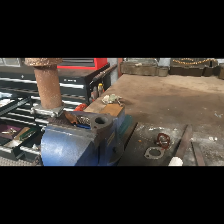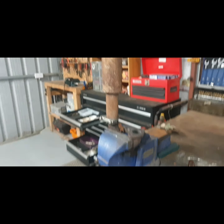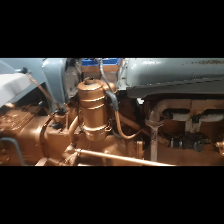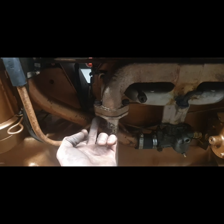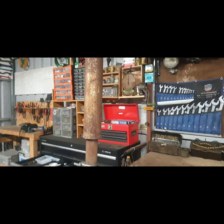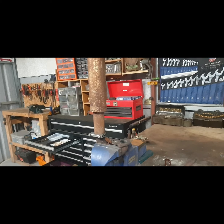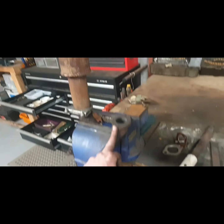At least now I'm in a position — because I've drilled and tapped out the studs in the other manifold — I can now take this off and put it on anytime I want, if I do want to see what it sounds like with the vertical exhaust, and then easily put back on the underslung exhaust. With this manifold I had to drill out the studs completely, but I put in bolts. With the other one I drilled and tapped, so I'll be able to use bolts that look a bit neater and more original. I'll be able to use this — it's a Burgess exhaust, or Burgess, I don't know how it's pronounced — and I'm fairly sure that type of exhaust was fitted from the factory. The baffler is probably a little bit gone, but I'll be able to put it on easily now by just removing two bolts.